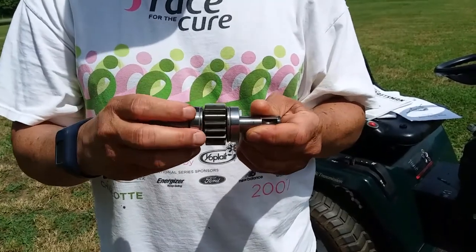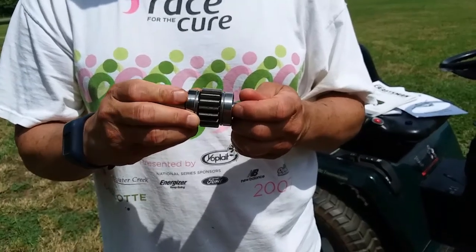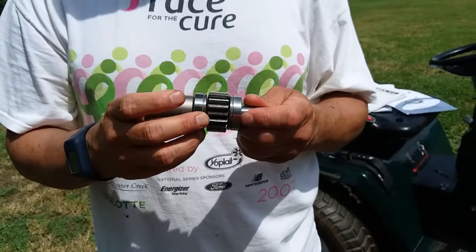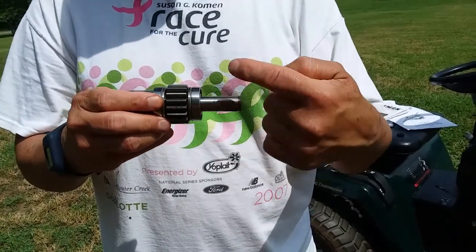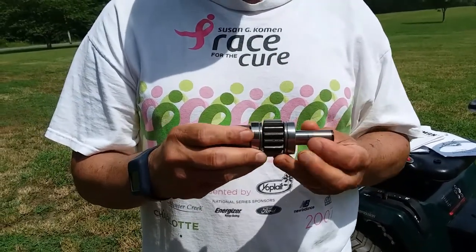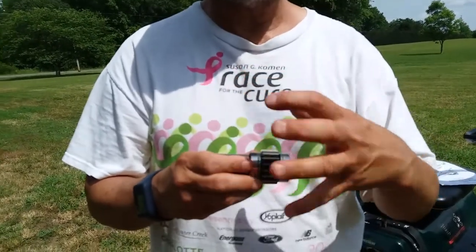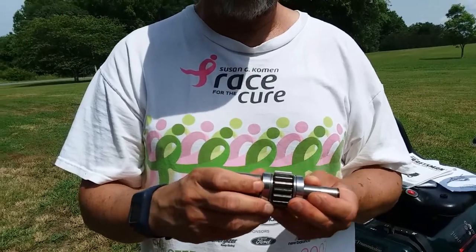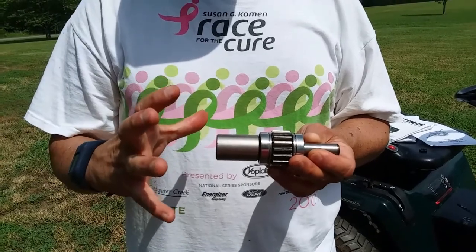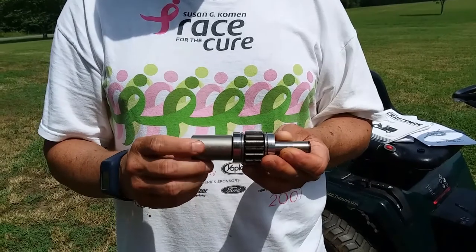This gear here, which you can see is in very good shape, though I've had this mower since it was basically new, for, gosh, over 15 years or more. I've had it forever. And then right here is where the brake disc goes. So this one little assembly, which you think is just more for the brake, actually is the whole basic drive mechanism for this transaxle. The pump from this gear is what gets the power to your tires.